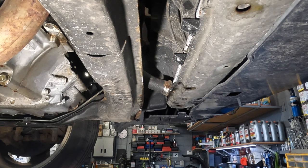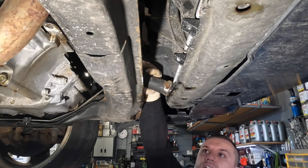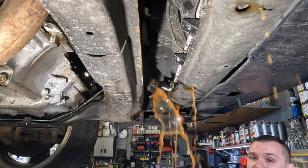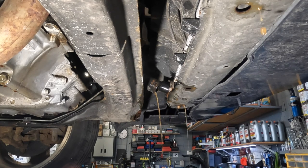This is going to take a couple of days just because of the time required — I don't want to just leave the car running outside unmonitored. So I went ahead and got about four hours on the first flush. I figured you guys would want to see what we're getting out on the first drain, so I'm removing the lower radiator hose on camera. Let's see what we get — oh wow, look at that! We're getting a good amount of stuff out, and it's fairly orange in color. This stuff is working — we are getting a majority of the rust out.